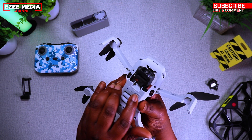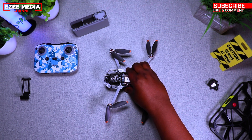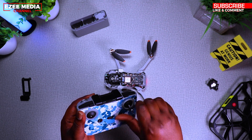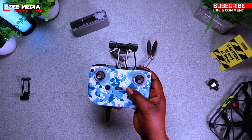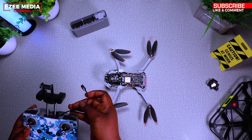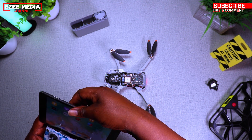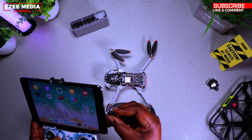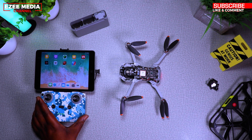I'm going to turn on the drone and make sure everything is intact. Before, the drone was unable to start — the propellers were unable to start with the old faulty GPS module. Now that the module is replaced, I'm going to see if it's going to start up and attempt to fly. If you've had a GPS error and the drone is unable to start, it's the GPS module that is faulty — you just need to change it.